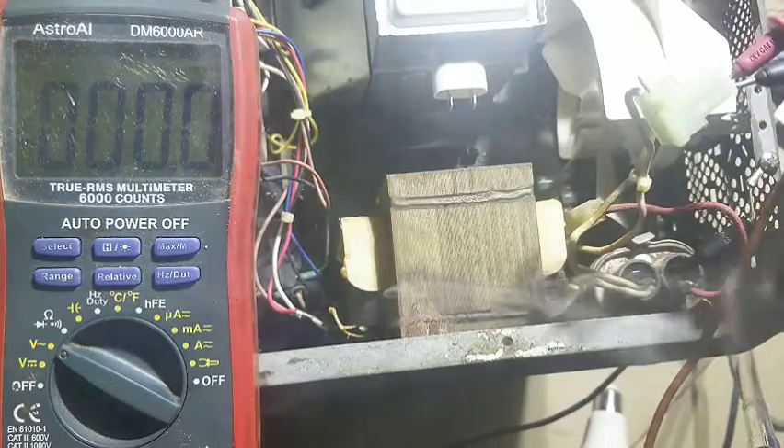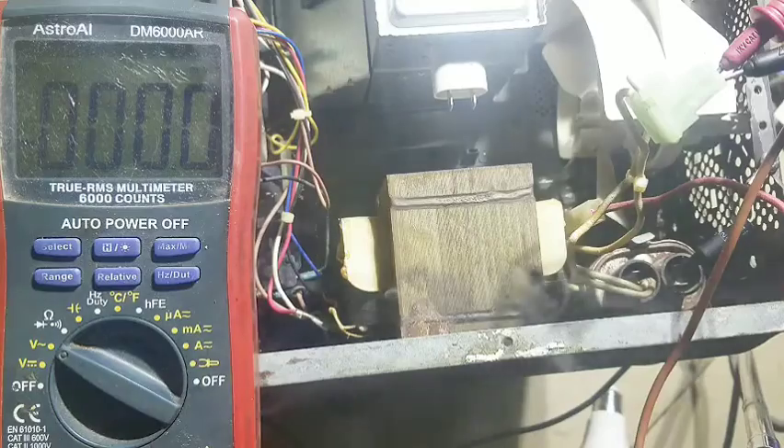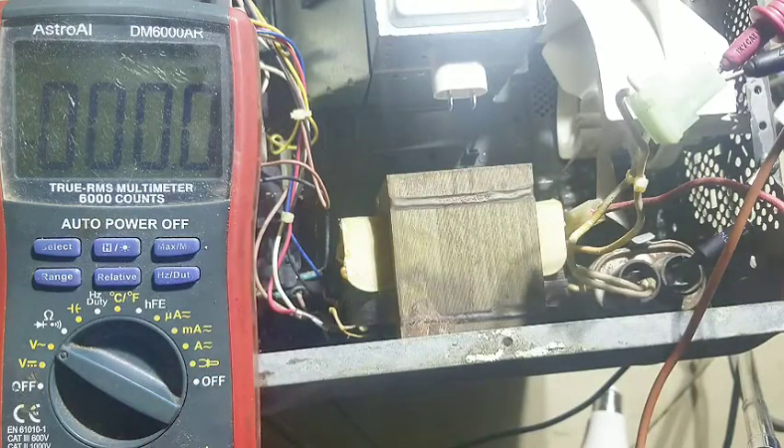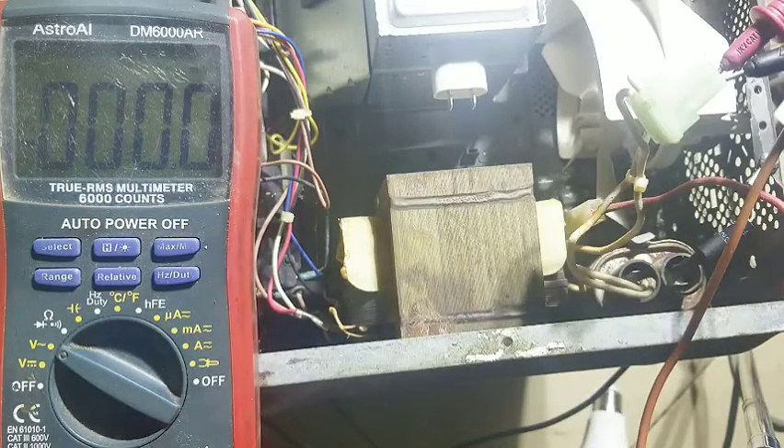So guys, finally I achieved what I wanted to show you. I like how this whole thing went down because this is telling me something I haven't seen before. I can say that it could actually mean the magnetron has no problem, but the problem is sitting between the capacitor, the diode, and the transformer. The transformer could not be the problem because the transformer was verified working — but it's actually hot right now. The problem is still somehow like a mystery. I got another capacitor yesterday which I tested and it's doing the same thing. For this moment I'm gonna cut it here and give you guys an update later about how I solve this. Subscribe and keep up with us — thank you for watching, bye for now.